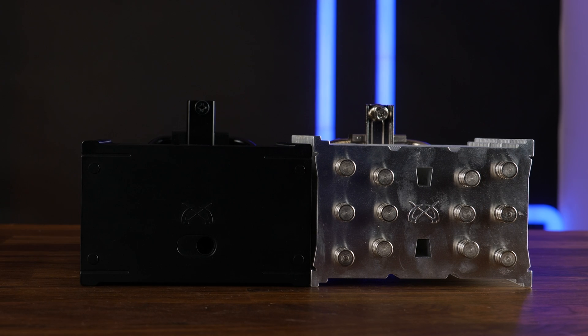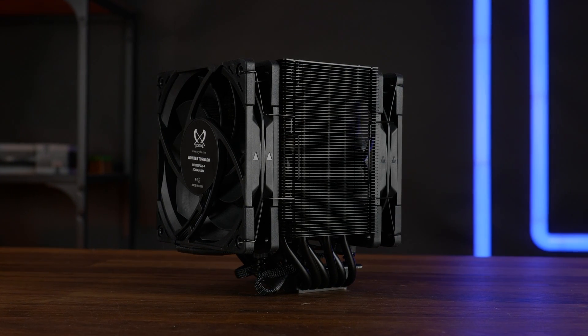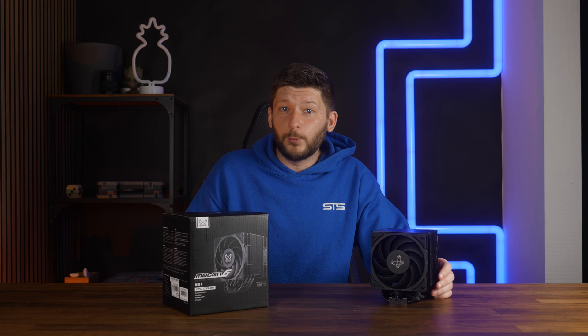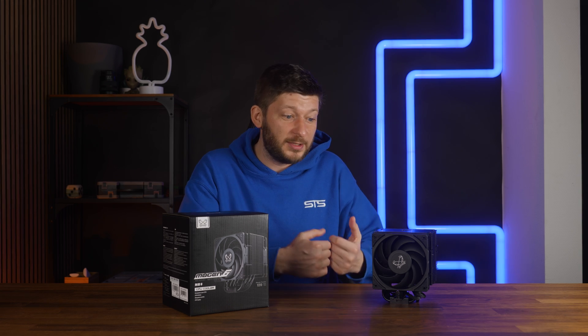And what the heck is this? The width actually changed a bit — at about 80 millimeters thickness, the heatsink is now slightly thinner. But there are also changes for the better, like the change in base and heat pipe design. Very similar to what Arctic did with the Freezer 36, the new Mugen has its three inner heat pipes of the six further outside. The base might still be made out of nickel-plated copper, but now it's slightly bigger at 43 by 40 millimeters. Most importantly, the heatsink fin stack changed: where previously we had 38 fins on a total of 97 millimeters of fin stack, we're now looking at 55 fins on 109 millimeters — that's 0.5 fins per millimeter versus 0.39 before. A much denser heatsink means more potential heat dissipated, which definitely explains the shift in fan choice and the dual fan edition.